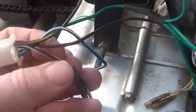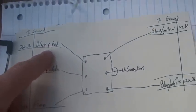You want an open circuit on the black and white. I recommend slipping a small jeweler's screwdriver into the narrow end of the connector to pull the pin out of the back, then tape it up, make sure it's floating, and your black and white is out of the problem.